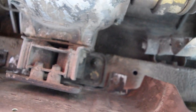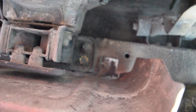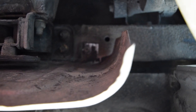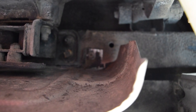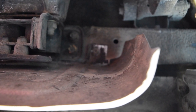This is where the differential mount is — right there on the differential. You can see off to the side there's a bolt holding this heat shield on. I believe those are 10 millimeters, there's one on both sides. The other side actually has a ground strap, so you want to make sure to put that back on. We're going to go ahead and take this off so we can access the bolts easily — it's just the 10mm on that side and the 10mm on the other side.